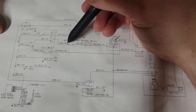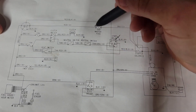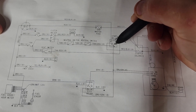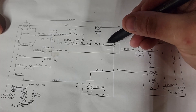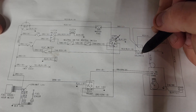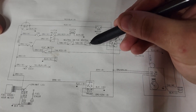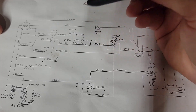The seat switch is wired in series, and when that works correctly it'll hit pin 30. When the relay coil engages, the contact switches over to pin 87 and goes to the starter solenoid — which we're not getting. So we're going to have to debug this neutral switch series circuit.